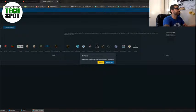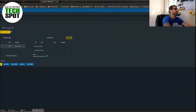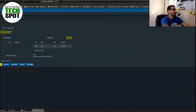So it says no pools, let's create a pool. Name of the pool, I'll just say main pool. How about that? Let's add an underscore, just in case. Encryption, I don't think we need encryption. Yeah, let's not have encryption for the time being. This is the pool it's going to be in. Wait a minute. Okay, I guess it's going to be in that pool. That's the only one I can do. That's it. We're good. Estimated total raw data capacity, 463 gigabytes. Let's go ahead and create a pool.